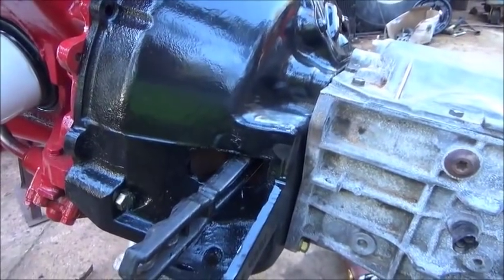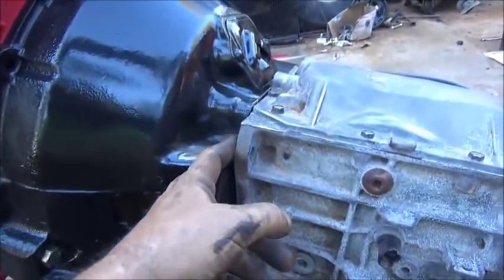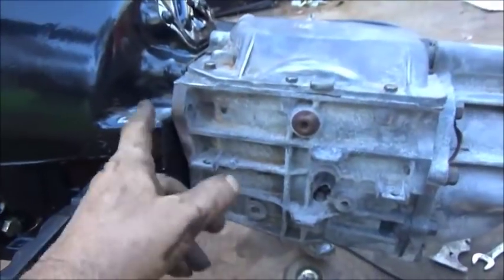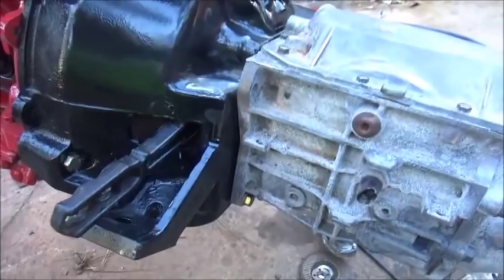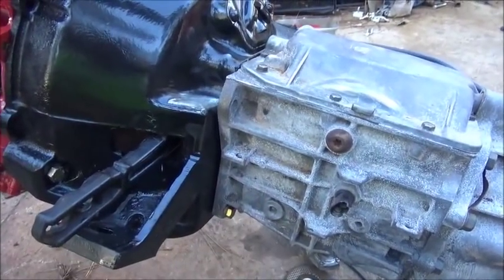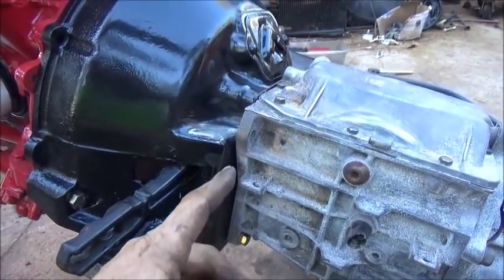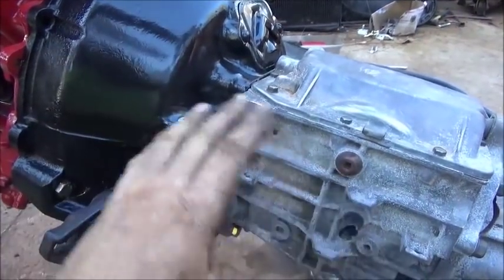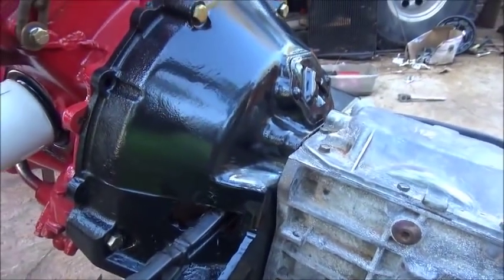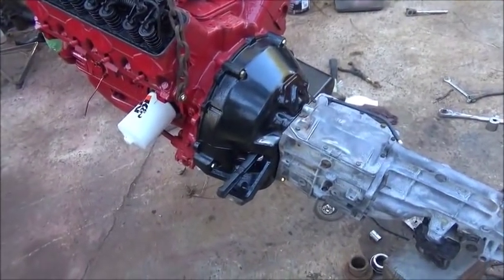All we've got to do is get something in this one spot — it's butted up good and tight, we just need to get an extra bolt in there. You know, I've run four-speeds and three-speeds with one ear missing and they held up fine, but we want to do all four just because. The center hole in this bell housing and this transmission are exact, so it slides in perfect — no side-to-side, up-down play at all. This is going to be just fine once we get this other one done.